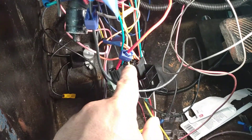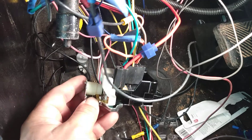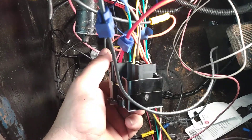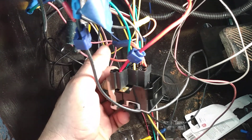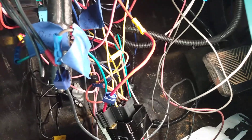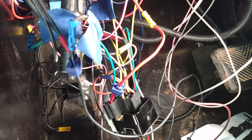So back to this: make sure that if you decide to wire one of these switches in for a custom job, or maybe you're rewiring a GM that has this switch, that you run a power wire to one of those orange wires in this harness, as you can see right there. That's what I wanted to share in this video — this gave me quite a fit, and hopefully it'll help some of you not have to chase down the same issue.